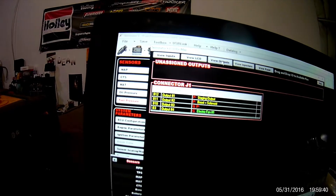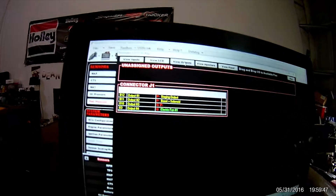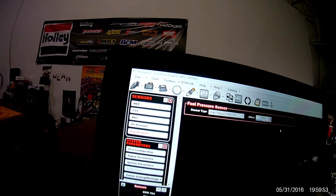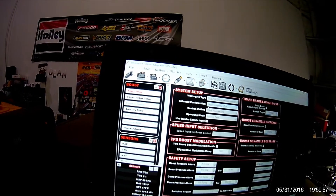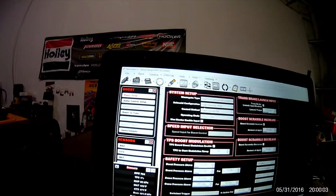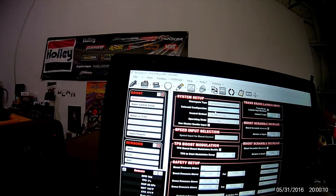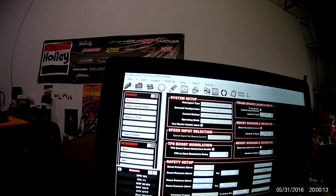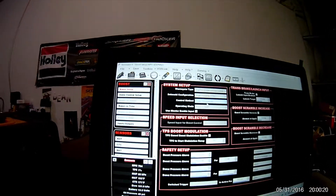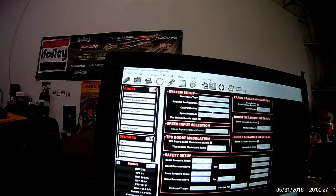Same with the outputs — I have staging output, boost solenoid, and electric fan. I need to do electric fans otherwise I'll forget to turn them on, and everything works perfect. For boost, they have dual port or single — I chose single Humphrey three-port, but I do have dual solenoids. I run one on each turbo, so it's basically the same as running a single — it just splits the signal between the two. You can only do dome pressure, and Matt Haple from Sloppy Mechanics has a good strategy where instead of adding a transducer for dome pressure, he actually stole the MAP signal.